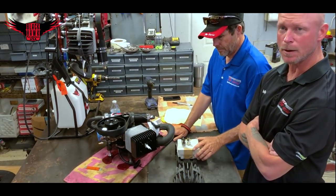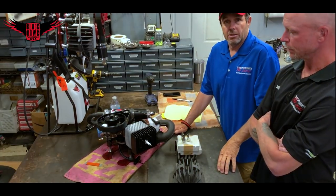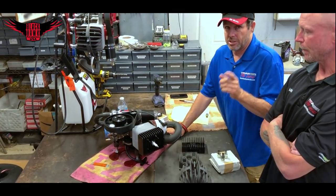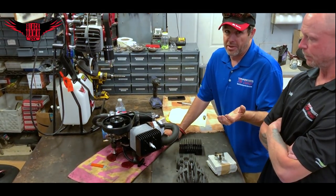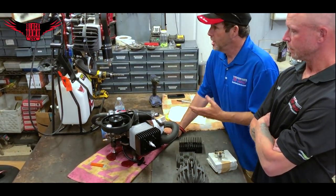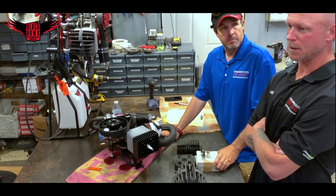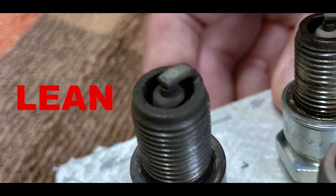Do remember to keep your head torqued. This engine will take you three minutes to torque. That way you're sealing the O-ring and the base gasket. If you see any leakage, it's because you didn't torque the head down. Remember: overnight cold — you cannot torque it when it's warm, it must be cold to the touch. 125 inch-pounds on the 125, and 180 inch-pounds on the Talon. What we try to do when training people here is get them in the habit — as part of their pre-flight — of checking the torque on their prop and the torque on their head. It's real simple and takes just a minute.